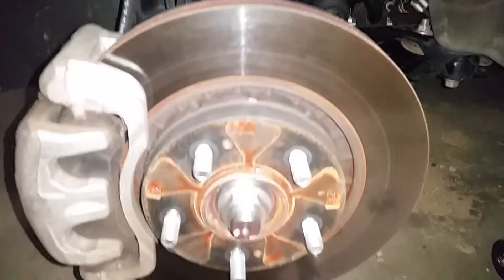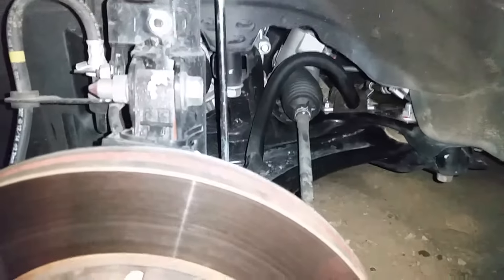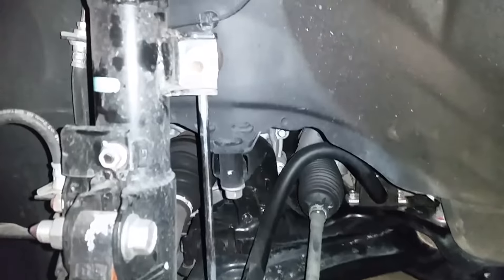What's up YouTube, I'm back and with the tire off. So after that last video I decided to do a little more research, and this seems to be a big issue with the Lancers. A lot of times when you install aftermarket springs or coilovers, you'll hear clunking noises, rattling noises, anything under 25 miles per hour over little bumps or turns.